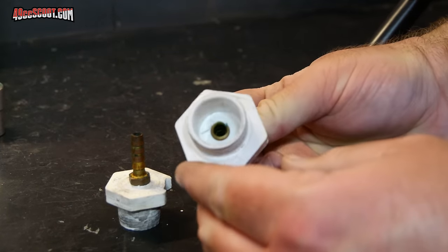If you decide to pump air in through the exhaust side, I have done that before. You would build something like this — just a piece of 3/16 or 1/4-inch aluminum drilled to match the bolt holes on my exhaust flange, then drilled and tapped for a hose barb. That would just be sealed to the engine with RTV and bolted up to the exhaust flange just like installing a header. That would allow me to pump pressure in through the exhaust side while the intake is just sealed. This is the least common way to do it — it ends up much easier usually to build one of the intake-side fittings.